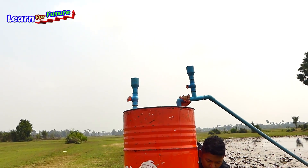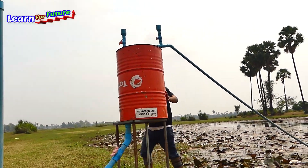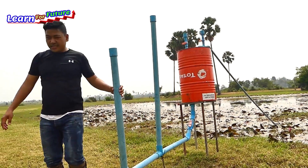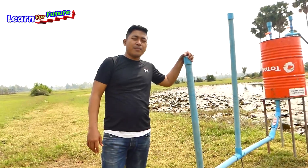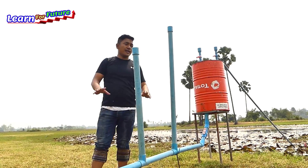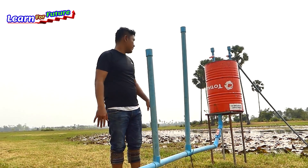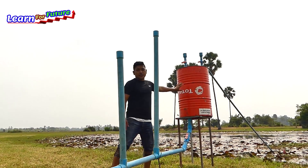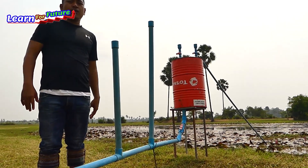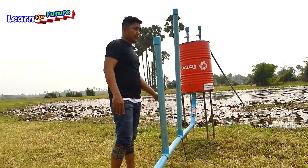It's working now. Thank you very much for watching my tutorial today. I hope you can do it at your home. Make sure the intake water level and output level are not much different — it's easy. But if they are much different it will deform the drum, so if you don't want to deform the drum, keep the difference just a little bit and tighten the output a little bit. Thank you very much, bye — see you again in the next video.